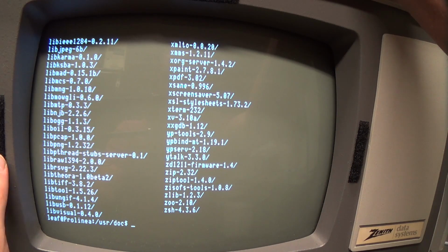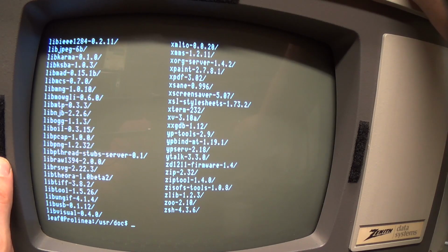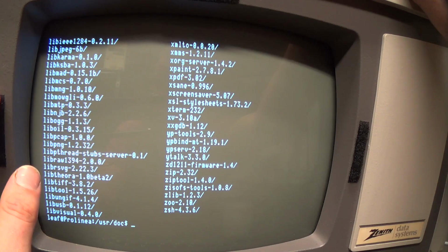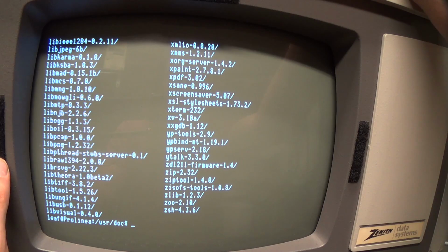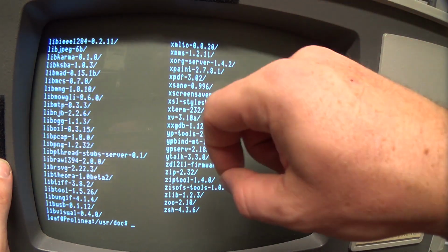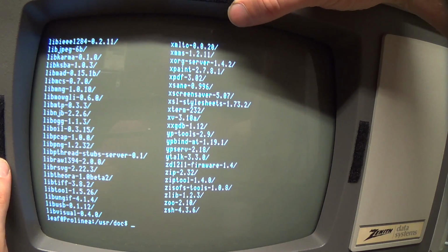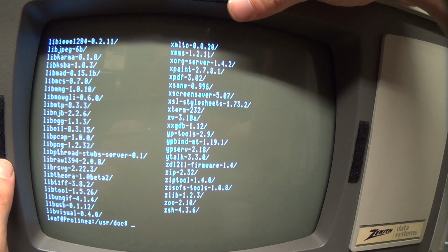But I was thinking about it later, and I thought, you know, like a lot of these machines, you'll generate a clock signal, and then you use a series of dividers to derive a bunch of different clock frequencies to run a bunch of different things. So if I study up on the schematics and figure out where all of those clocks are being generated, considering the age of this thing, they may be just being generated by discrete logic. If that's the case, we can probably tap into one of those other clocks, one that's twice as fast or 4 times as fast, and bend the clock pin up on the 16550 when we install it, and run a wire from there to a different serial clock on the clock divider circuit. And we may be able to get it up to, you know, like 38.4 or something like that, which would be quite respectable and very usable.